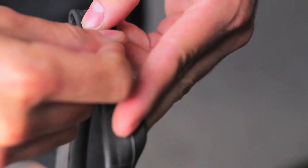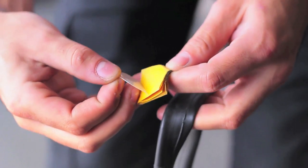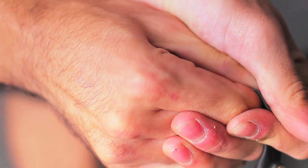You're going to want to scuff the area slightly wider than the patch that you're going to put on, so you make good contact between the patch and the tube. After you scuff it, you want to wipe it clean, getting any debris off the tube. Now I'm using a glueless patch, so all I'm going to do is adhere it and squeeze it together with my hands firmly for a few seconds to let it sit.